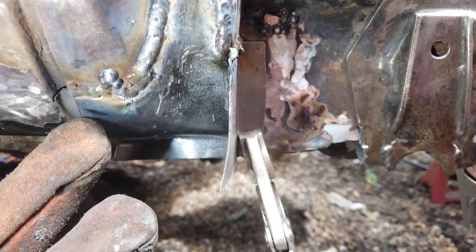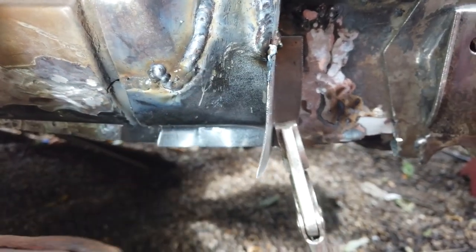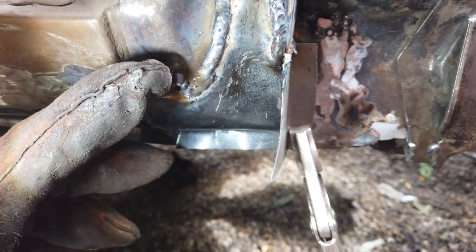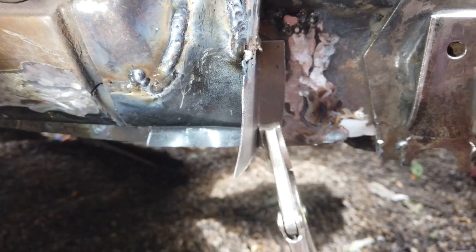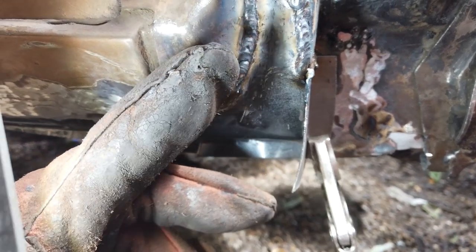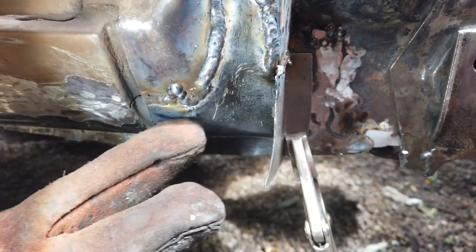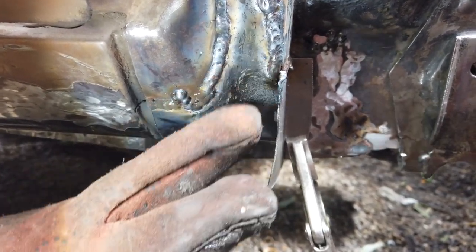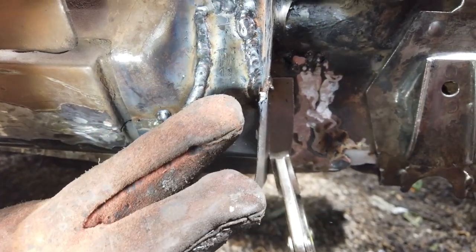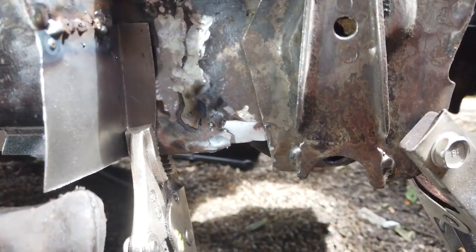Our sill's come in handy again - we've cut up sections of the sill, an eight-centimetre-wide piece, and that forms this sort of cup which the sill would originally have pushed into. That cup being the A-pillar bottom - they always rot out. It's actually a hollow section that the sill slightly slots into. Using another piece of sill we've made another repair piece. As you weld you can hammer it into shape because you get a stretching motion going on - get some tacks in, you can shape as you go.